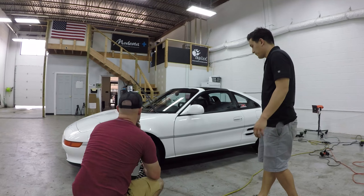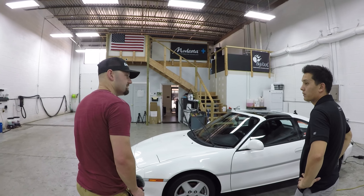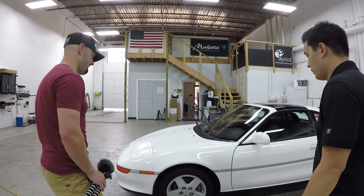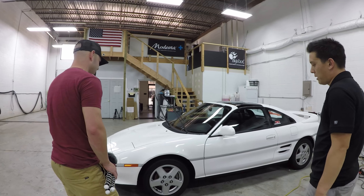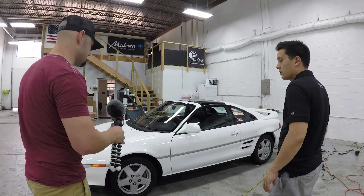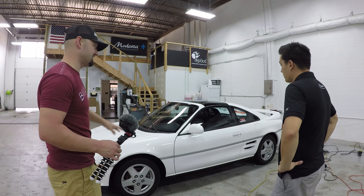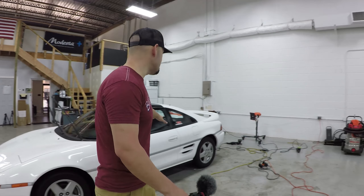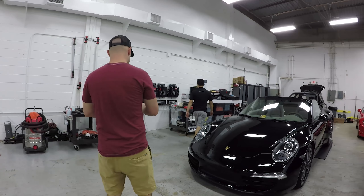For the lower plastics there are different things we can do. We could even put it up on the quick jacks and actually pull the wheels off, clean the wheel wells, restore the wheel wells. There's a lot of things we can go through. If you look at the overspray area, it's approachable. With overspray you might have to use a heavy lacquer thinner to break the paint apart, then it'll fall out of the plastic, and then you have to restore the plastic. It really depends on the severity of how bad the paint's stuck in there.